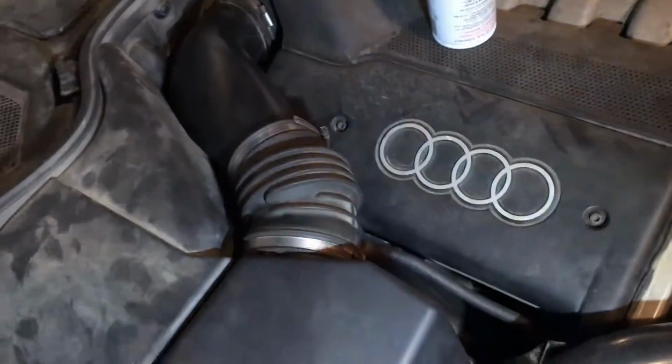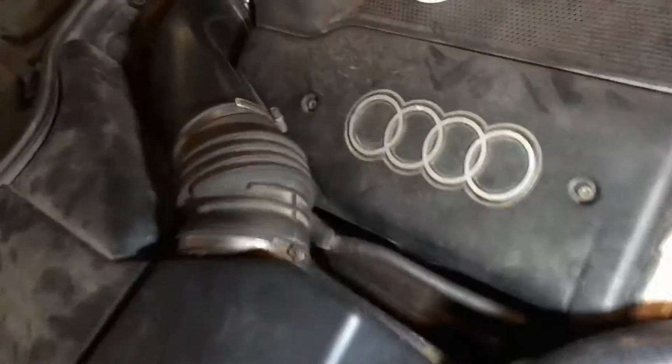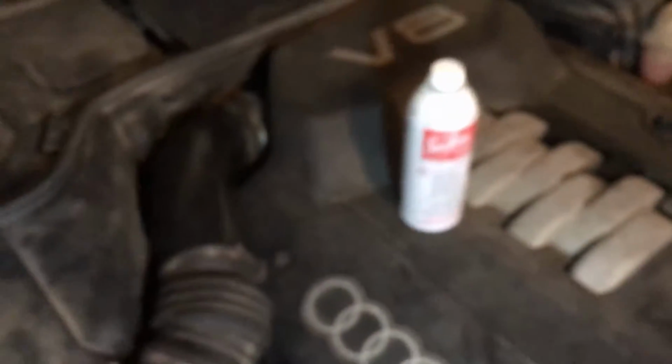We're going to pull off the airbox. Down there is our oil sensor and oil pressure sensing plug. We're going to pop that thing out. You can see that tail right there. We're going to pull that out, hook up an actual oil pressure gauge. We're going to run it low and go to different rev ranges, see what it does at idle, 2, 3, 4,000 RPM. And then we're going to let it warm up and see how much it drops and see what it does at those levels. And that'll be our experiment for today.